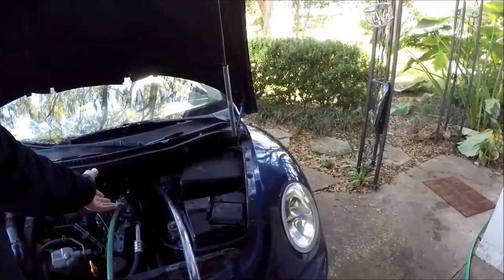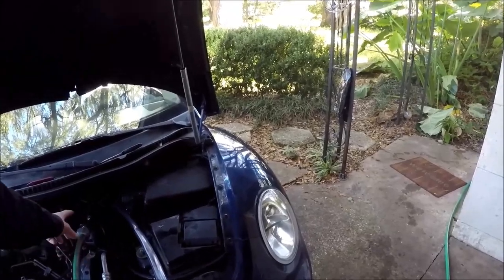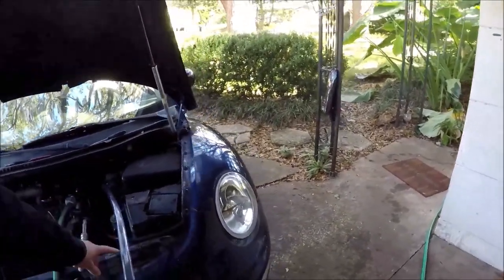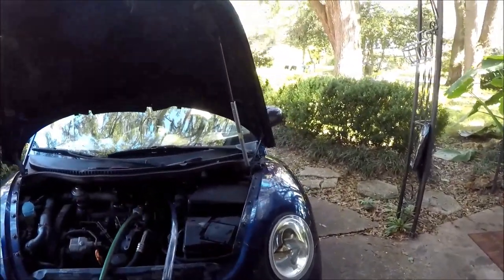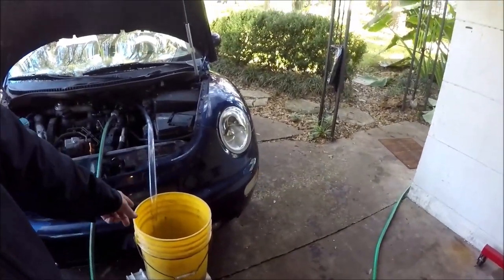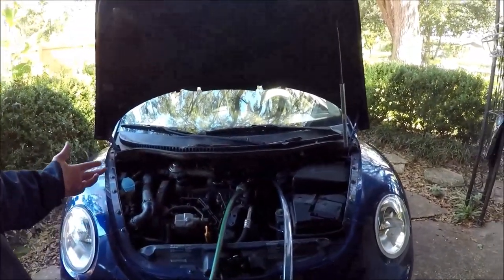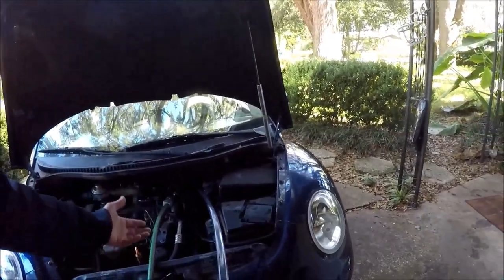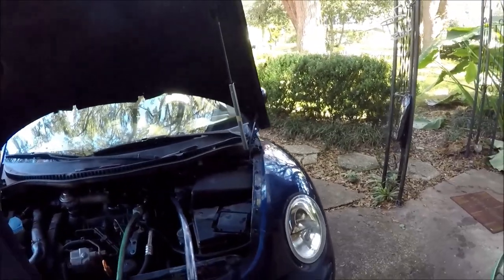With a little bit of editing and some film magic, it's already done. We have our hose hooked up to the outlet side because you want to flush it in backwards. We have our clear hose so you can see all the junk coming through. Now, you always want to have it running into a bucket because this stuff is toxic — not good for the environment. If you've ever opened a bottle of antifreeze, specifically G-13, it smells very sweet and animals like to drink it, and it will kill them.